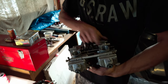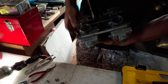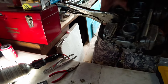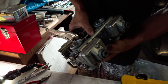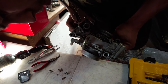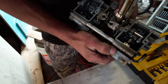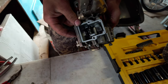Let's try a half throttle. There we go — full throttle. Not quite full throttle. It's half throttle, just a little sweet spot. Can't see in that crack. There we go — that's the thing it's hanging up on. Should be free, but the little pin's still in that hole. Maybe we've got to take that pin out.